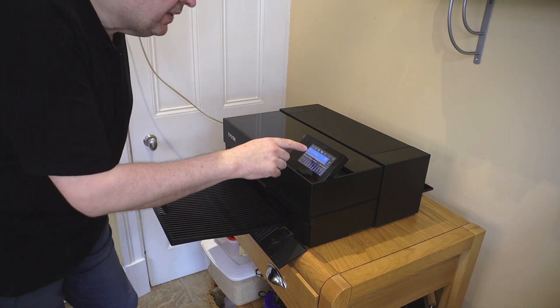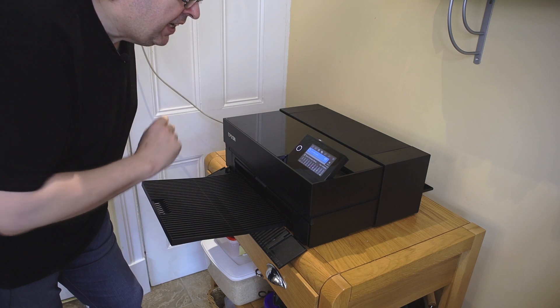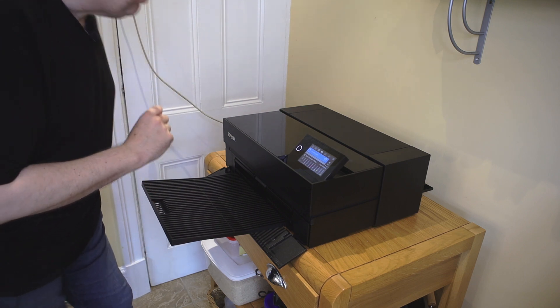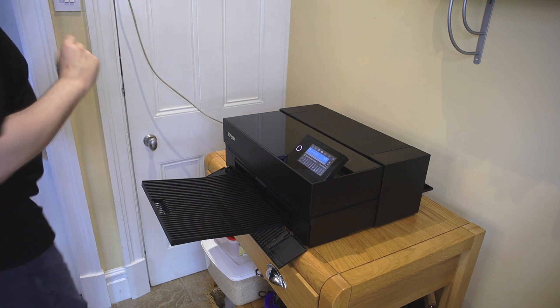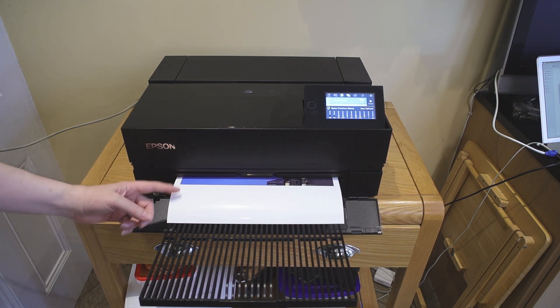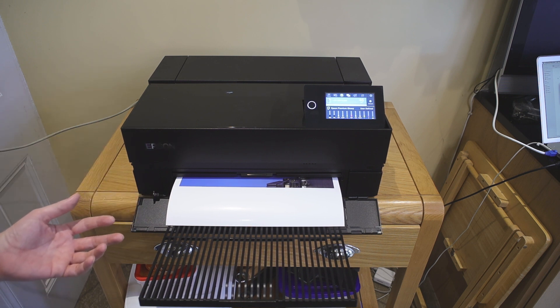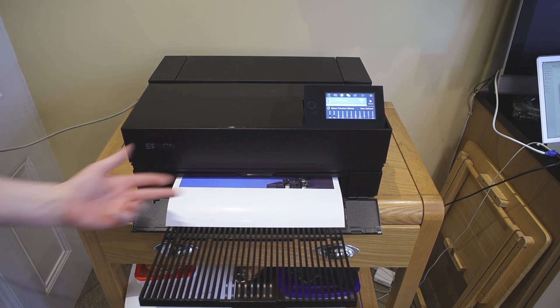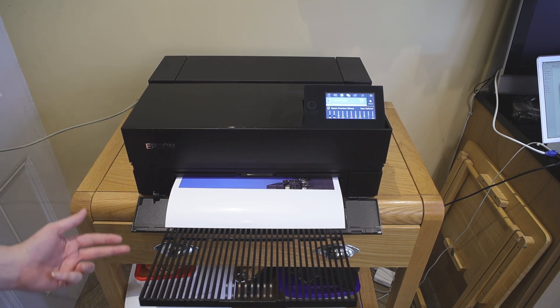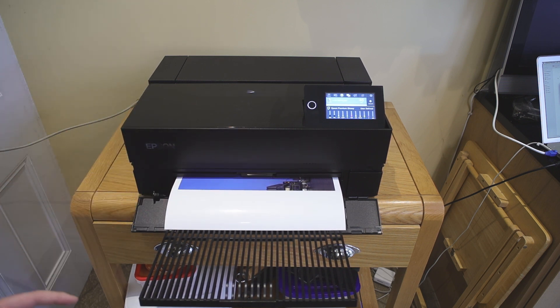The display is now showing the name of the file — it's a Photoshop PSB file — and it's telling me it will be ready in approximately 49 minutes. The print is starting to come out of the printer. One observation: the printer always adds a bit of paper at the front of the print. For prints like this without a built-in cutter, you sort out margins afterwards. The half-inch margin I specified above and below has come out fine.